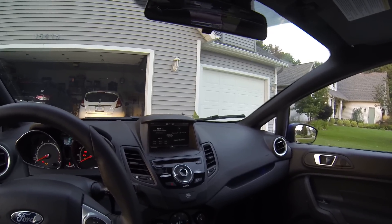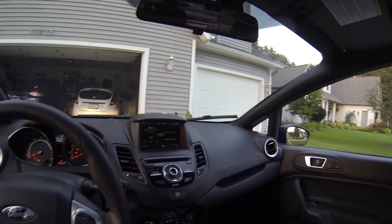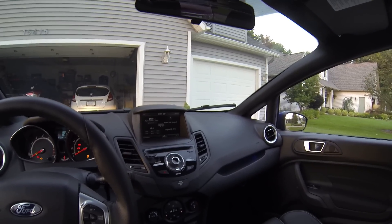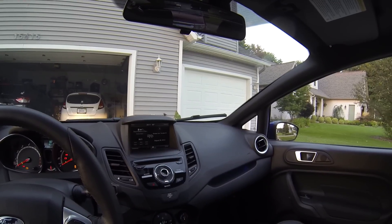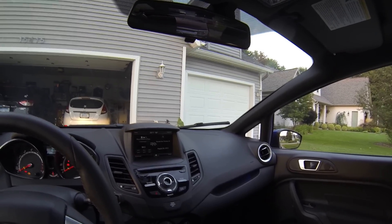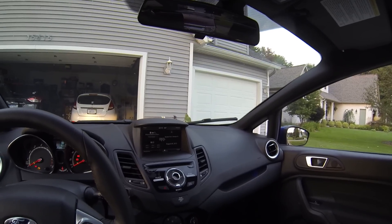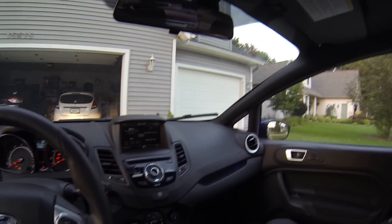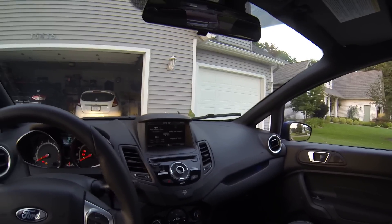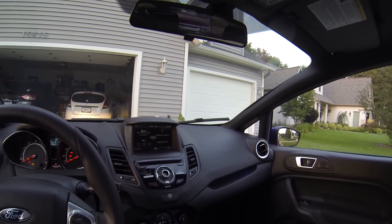One of my favorite buttons: ESC off — desperately missing on my 2011 car and a constant source of frustration. In its default state, stability and traction control are on. Hit it once and a yellow light pops up on the dash — now you're in sport mode with a little more wheel slip and yaw. Push and hold for five seconds and the system is fully deactivated. On the track I use sport mode; autocrossing I go fully off; on a road course I leave it in sport; and on the street it stays on — except in winter where I'll turn it off and use left-foot braking techniques I learned at Team O'Neill.